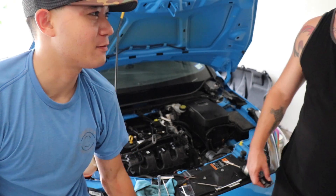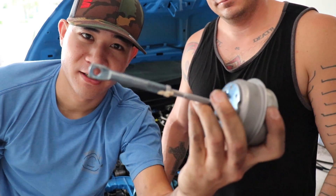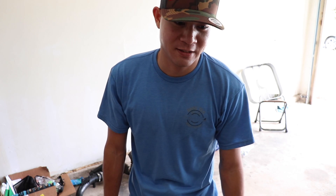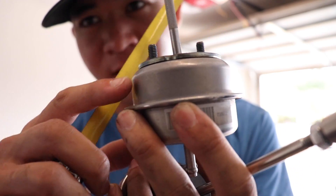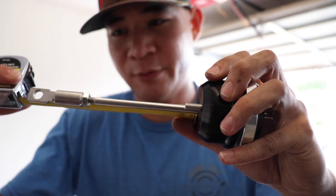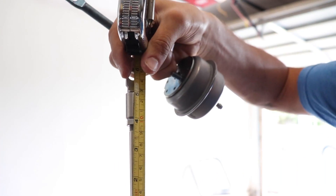After 35 to 45 long minutes of working, we got the actuator out and got the snap ring off. The snap ring disappeared on us somewhere in the depths of the engine bay. I got the preload set, but when I was measuring I was measuring from the plate — I forgot the rod continues past the plate. On the TurboSmart wastegate actuator, all you've got to do is go to the base of the wastegate actuator, measure out to the center of the hole, and align it correctly.